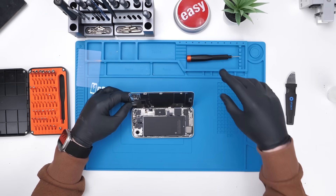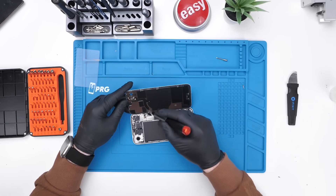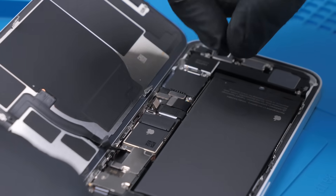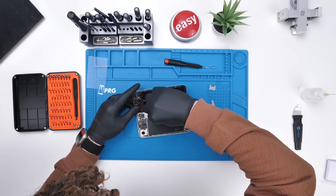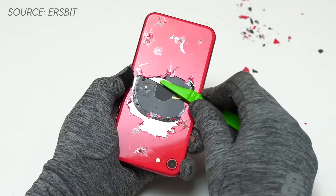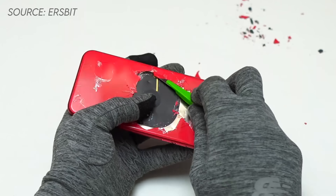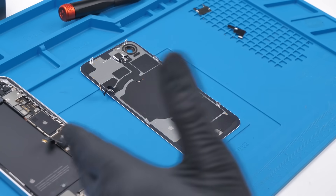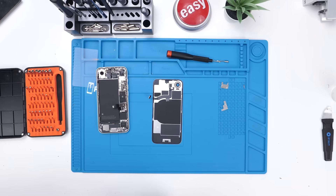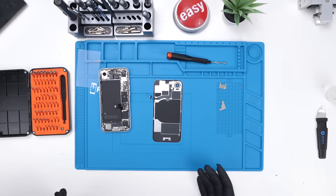Let's go ahead and unscrew this plate to get that back glass removed. Before we disconnect the back glass, we have to disconnect the battery. We'll disconnect both and remove it. In all prior SE versions, back glass wasn't something you could remove — it was glued to the actual frame. But going forward, Apple seems to be adopting this new model where the back glass can be removed, which I'm grateful for.